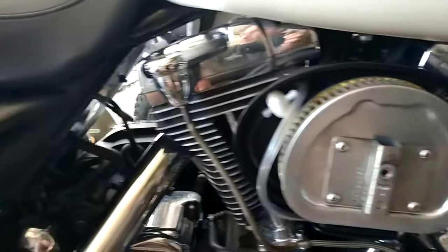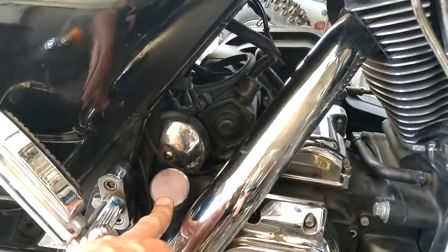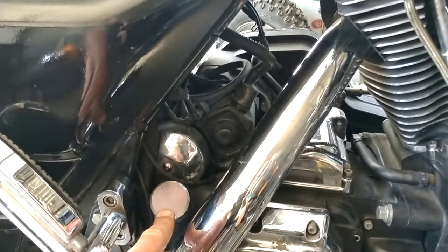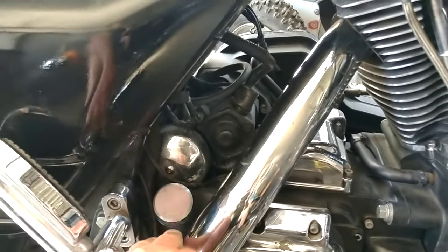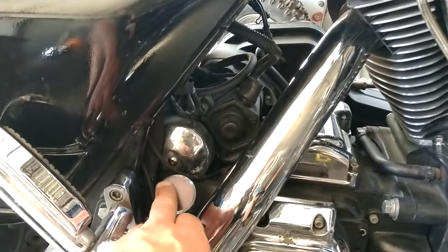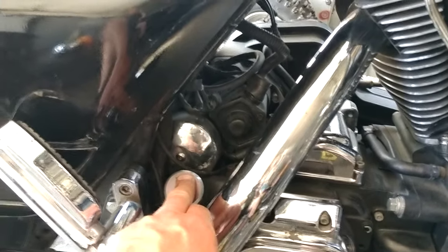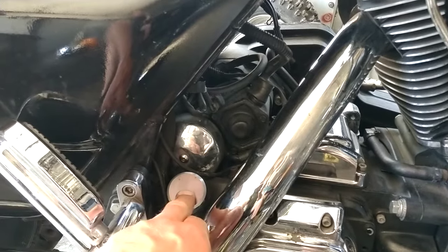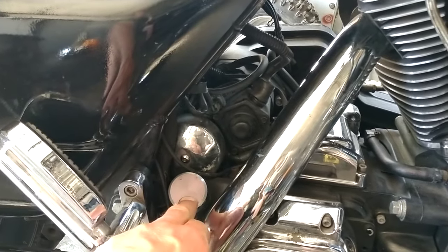Let's start at the source. The source is the oil to begin with. I suggest you run on the low side of the safe zone. I'm using the cap here as if it's the dipstick. If you're running high in the safe zone all the time, really full on oil, that makes the problem worse. Try and run low — maybe halfway into the safe zone at the most.